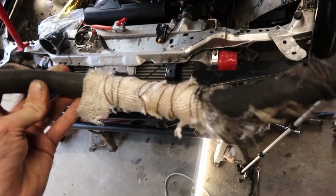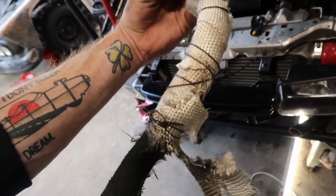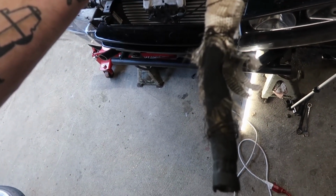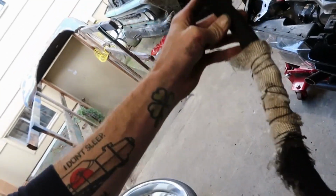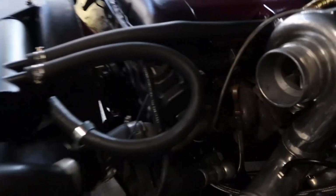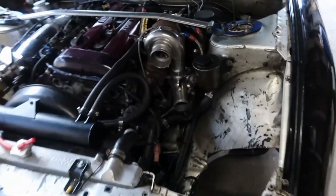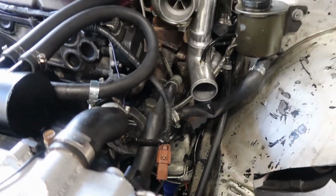I'm gonna give myself a C-. The heat wrap worked, except, see if that focuses, where the fireballs were coming out of my wastegate dump. And it just got to the inner liner of the hose. Melted the heat wrap off and everything, so yeah. That wasn't my smartest move ever. I yanked the wastegate dump off. I'm just gonna go ahead and redo this. That is a chintzy ass flange I made anyways. It was just some random scrap metal. And then I'm gonna re-aim it.